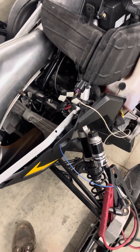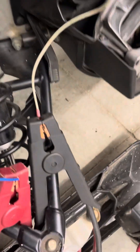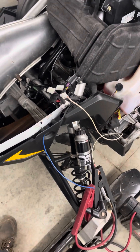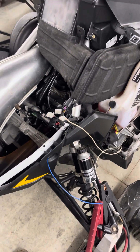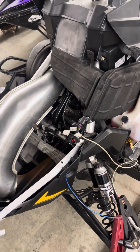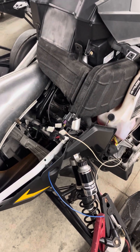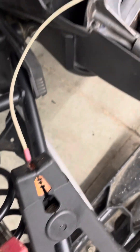Polaris will tell you that you need to fire up the DC power — you can see I have my ground here. You also need to fire your ACM power, which in this case I'll show you is not required. I always get a little nervous about firing up any sort of computer — in this case an ECM, could be a body control module, even your power valve solenoid. You're better off leaving the factory electronics to power that up anytime that's possible, so I figured I'd try it and it does work. Simple ground.